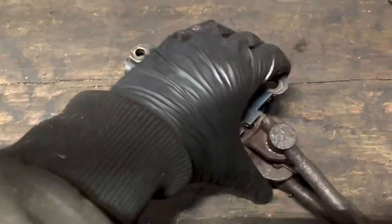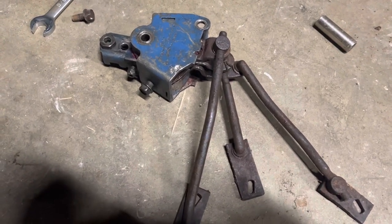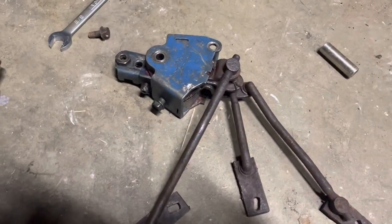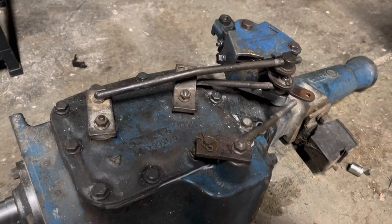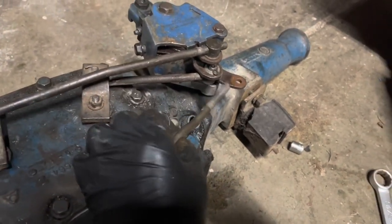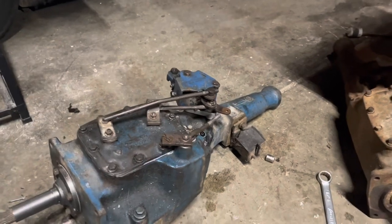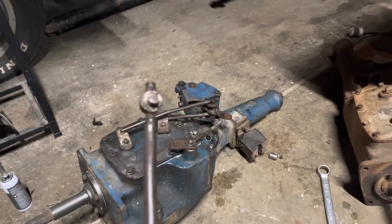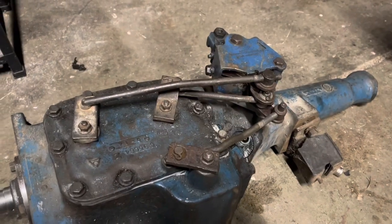That was a messy job, but someone had to do it. I think it's going to be nice — that's the smoothest moving one I've ever seen. I left the wrong shift rods on there the whole time so I could easily identify which is which. I know reverse is the long one, and 3-4 is the other long one but it doesn't stick down as far. Now I'm going to swap them out for the right-ish ones. The forward gear linkages worked perfectly. I had to make some modifications for reverse — this was just a random one we found in Tom's collection, and the dingus end was too big. It's a little funky but I think it's going to work. The one from the overdrive van transmission was seized with hardly any threads left, so this is going to have to do. Looks like a shift linkage to me.